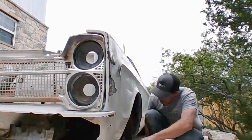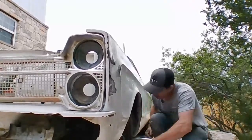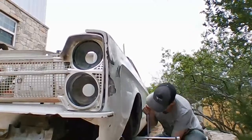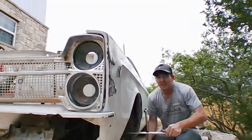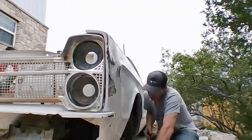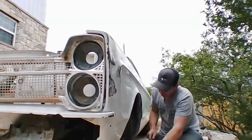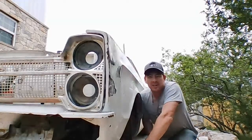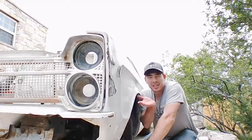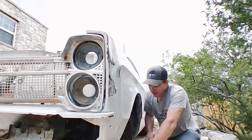All right, grab that jack and take it back on the passenger side. Okay, it doesn't need to go. I'll show you where to put it. But you got to do the back tires differently, boys. The tires and rims on the back on the 65 are exactly the same as what I normally see on the 65 Fairlane, where you actually have to jack the body up by the spring perches or the spring connectors and let the axle sag so that you can swing the tire and rim out.